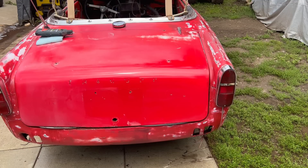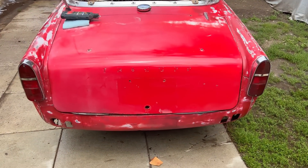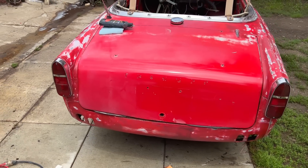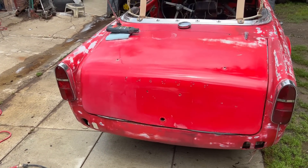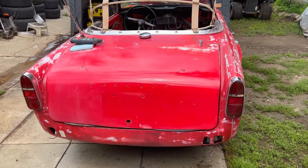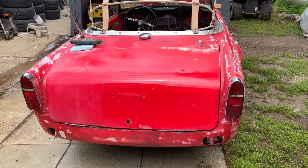You can see the difference between the right side and the left side — that's kind of where we're trying to get to, just to the point where you can bring the paint back to where it's a little bit shiny. We'll have to dull it down with the Scotch-Brite prior to clear coat, but at least it'll bring the color back. The pad's pretty dirty and some of the compound is sticking, which is a little bit problematic — it's so badly oxidized.